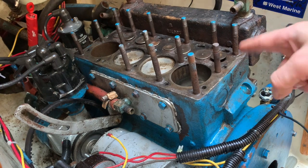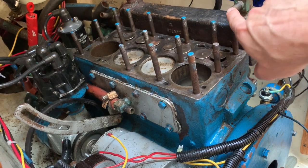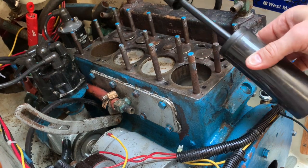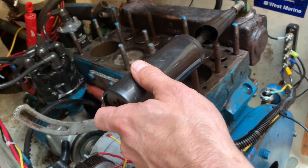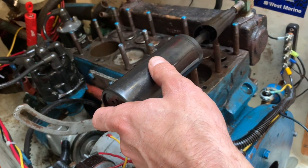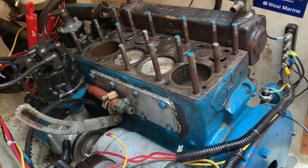Today, clean head. I take this off — thank God. I blasted air through here with a little air pump and compressor, and water shot out back there, which is a good sign that there is water moving through this exhaust. So the water pump is working.